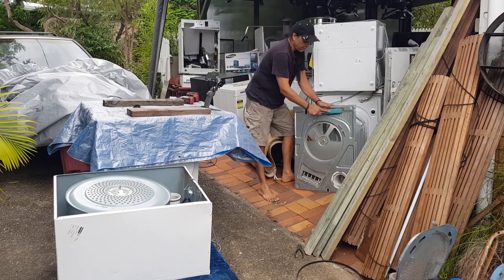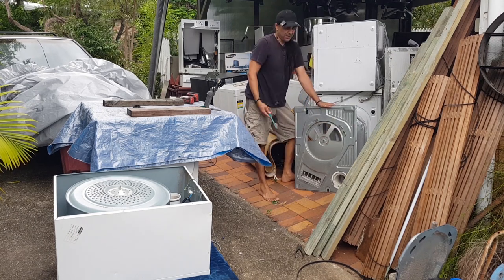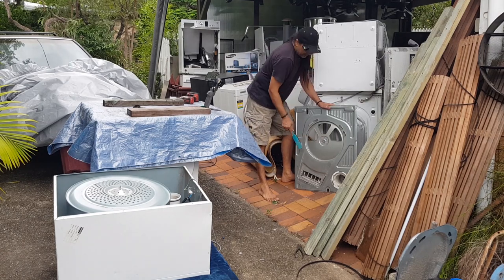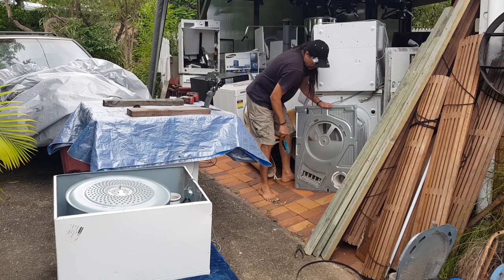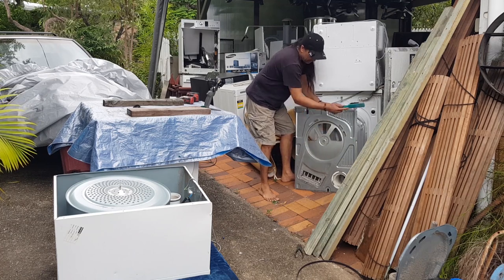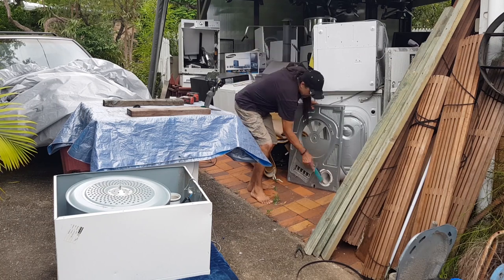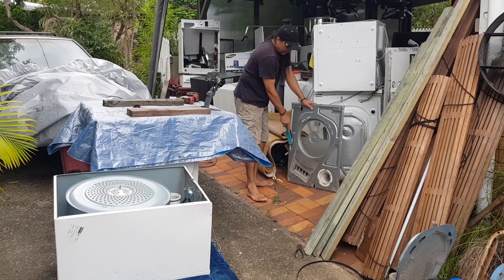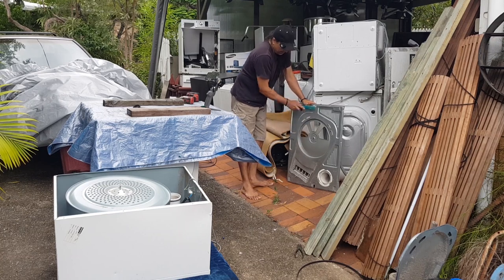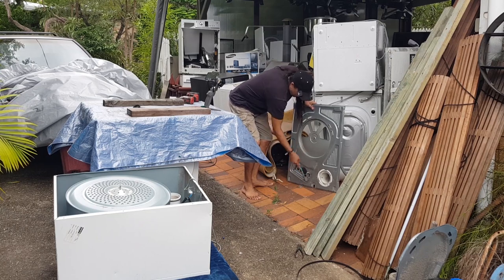They come to buy a dryer off me and they say, oh, it's going to catch on fire. I can smell it burning. And I just open it and there's nothing wrong. It's just a little bit of dust that's hit the element. The element gets hot and it just burns it away, and people smell that burning and just think it's dodgy and it needs to be replaced. Most of the time, like 99% of the time, it doesn't. I would just let it do its thing, just keep an eye on it, and it will go away.